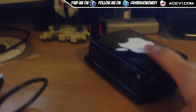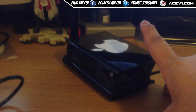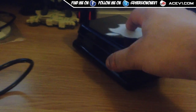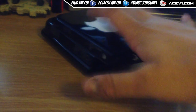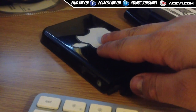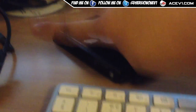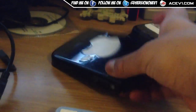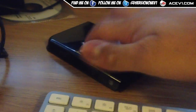Another fix that my friends told me was to freeze these drives. Now freezing them is interesting — how the hell do you freeze a drive? The other thing you can try if it's not reading is to tap the drive. Never tap the drive on the top — because this is a plastic casing, if you push onto the top of the drive you're pushing onto the head, and it's going to scratch the platter. If you are going to tap the drive, just tap it on the side. I've already tried that and it hasn't worked for these drives. So I'm going to show you exactly how I'm going to freeze these drives.